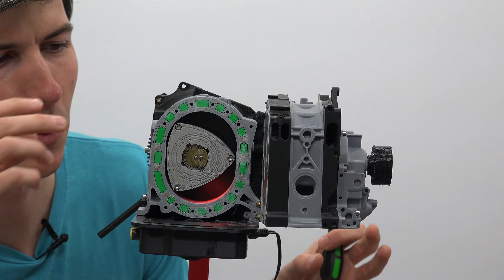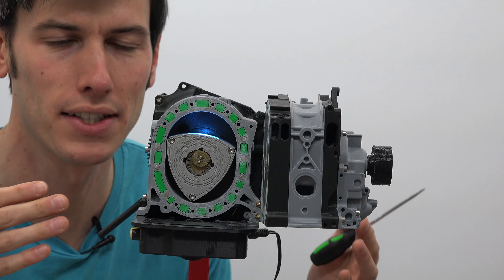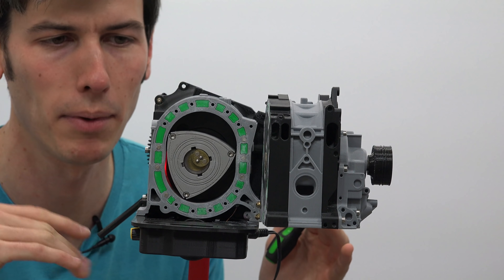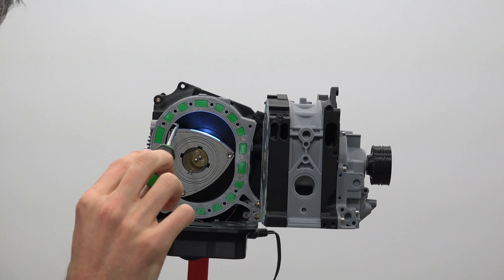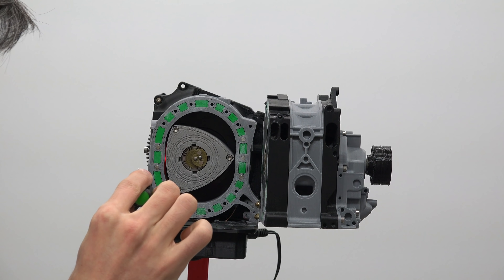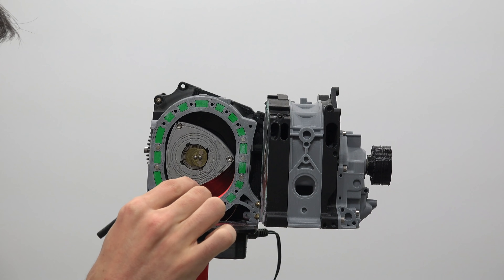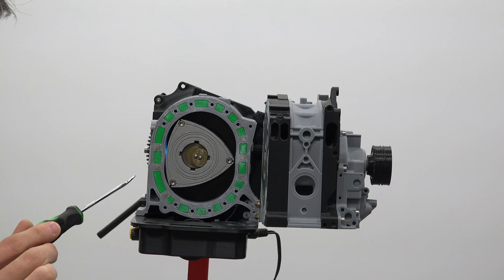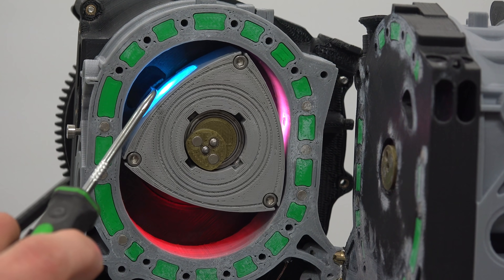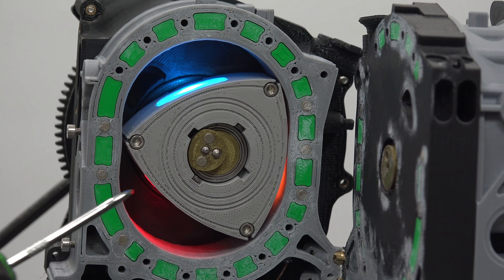Here's what's really cool about this 3D printed model — the rotor actually has a light on it showing us the combustion process. Just like a piston cylinder device has those four strokes — intake, compression, power, and exhaust — this does those same four things, the difference being it's not a reciprocating mass, instead it's rotational. Looking in the engine here you can see that as it rotates over it pulls in that air, compresses it, you've got your spark plugs right here which ignite it, then you have your exhaust pushed out here. It pulls in fresh new air, fills up the chamber with air and fuel, the spark plugs fire, push the rotor to rotate, and then the exhaust is pressed out. It's not just one chamber active at a time — in fact there are three chambers, and all of them are simultaneously going through that combustion cycle.